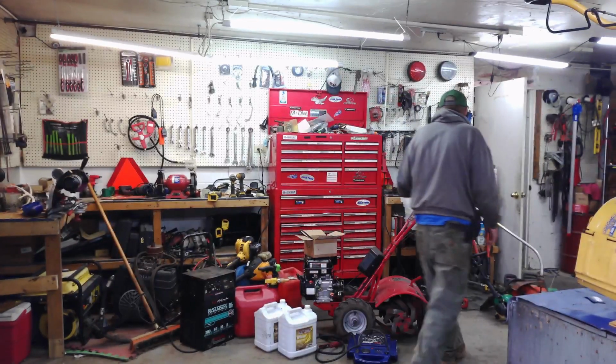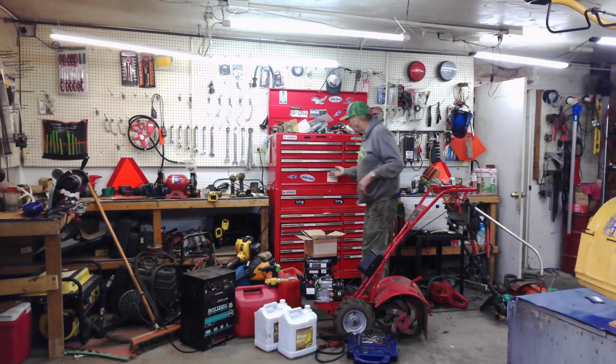So as you can see, putting the coils on isn't that difficult. You just loosen up the screws that hold the case, the plastic head part, on it. That'll lift right off, take the air filter out, and that'll pop right off. And it gives you full access to the coils. And spark testers are a blessing in disguise, because you can show if something is not running correctly. You can listen for it like the old timers did, but I like a secondary thing, and that is when I put my spark testers on my coil wire boots, I can see how much it lights up.